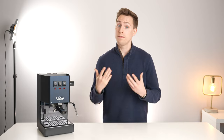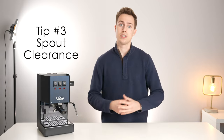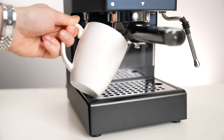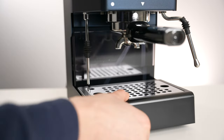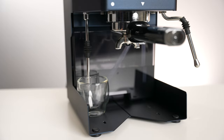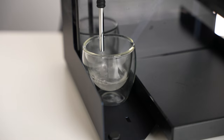Tip number three is a workaround for a very common complaint of the Gaggia Classic Pro and that is the spout clearance. If you want to use a full-sized cup or a scale with this machine, I recommend you actually fully remove the drip tray and simply place a small cup underneath the solenoid outlet. The thinner and taller the cup you can find the better. Because this is the only water outlet on this machine you can use it safely in this configuration without risking a mess.